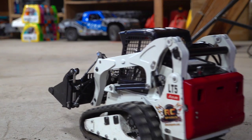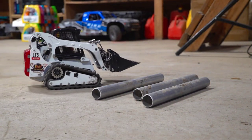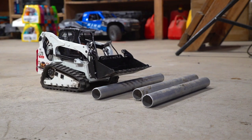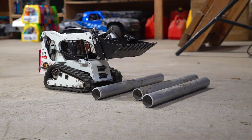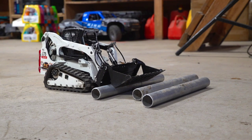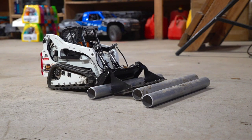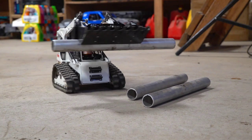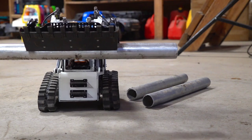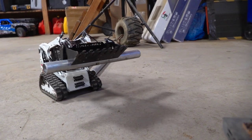In the last episode I showed that I switched out the dual ESCs — the dual speed controllers for the motors — for a single two-by-five Sabertooth dual motor controller. If you guys didn't see that, you can check it out — that's how I'm able to maneuver and use this so easily. Remember, if you are going to put one in, use the right gauge of wire on the battery port or you will experience a brownout. The BEC is pretty good on the Sabertooth, but if your motors are asking for more power and your wires aren't able to deliver it, you're going to get a brownout.